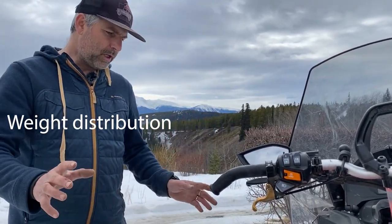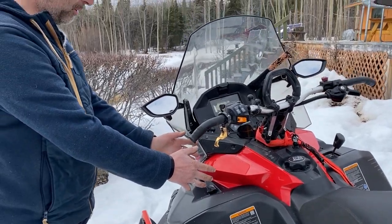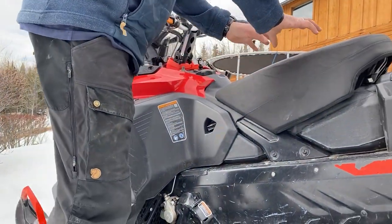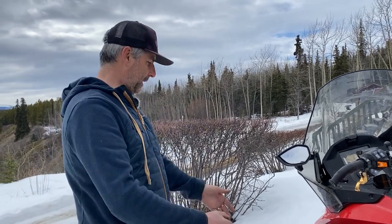I like it with the narrow skis because it stays super nimble. When I need to make a trail on the side I can keep the snow machine perfectly horizontal, not having a ski completely going down. The turning radius is just absolutely amazing — you can turn the machine in place because there's no weight on the nose. The engine is positioned far back, you're sitting on the tank, and there's not much weight in the back. That's a very great feature with the agility of the machine.